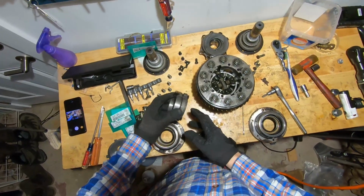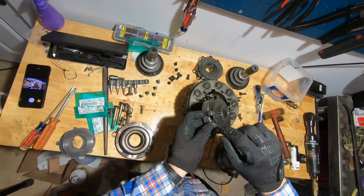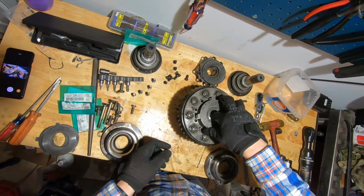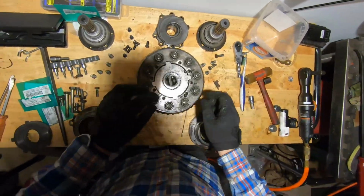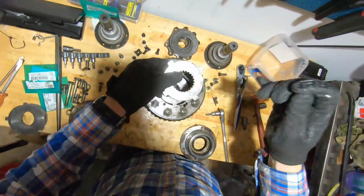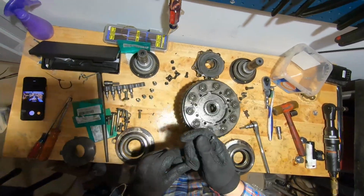All right, and then the next bit is the other gear with the splined bit that comes through this housing on top with your final set of clutches, or clutch and dog ear plate. So we'll just drop those in. And I've screwed it up by letting things slip. Here we go. Let's get that clutch on there, and we'll get that dog-eared plate back in there.